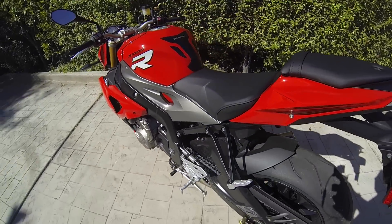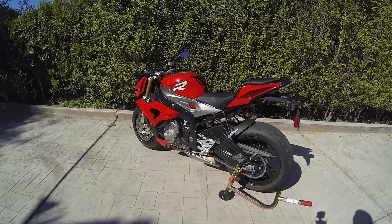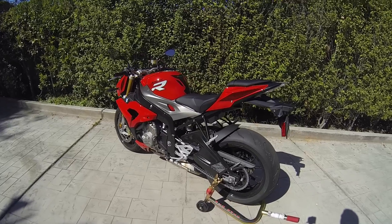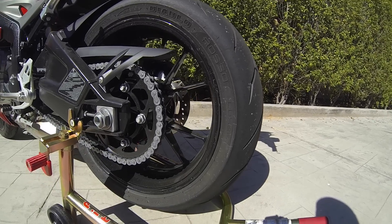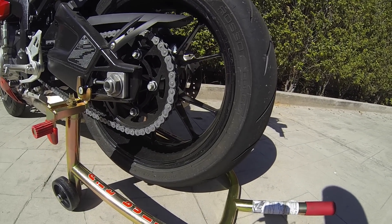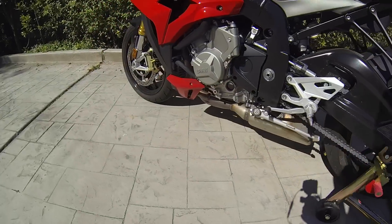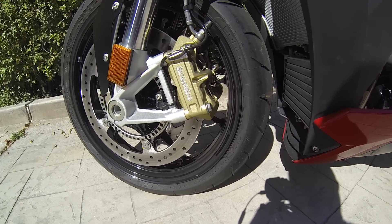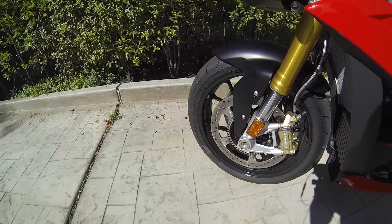Other than that, I'm very happy with the bike and quite like the design. I love the fact that it kept the RR wheels. This bike's got the Diablo Rosso Corsa tires — 190/55 in the rear and 120/70 up front. Standard sizes, and the 190 in the rear is the same as the RR. It's a nice big tire in the back.